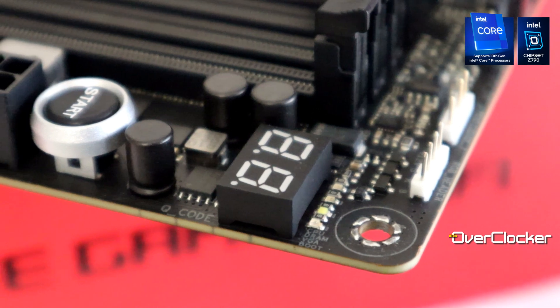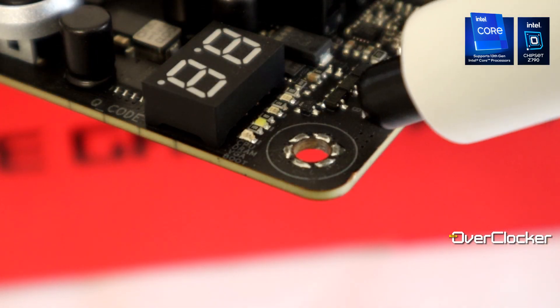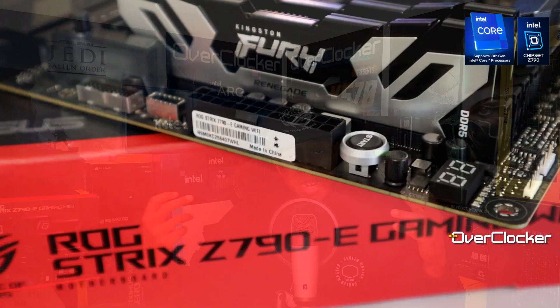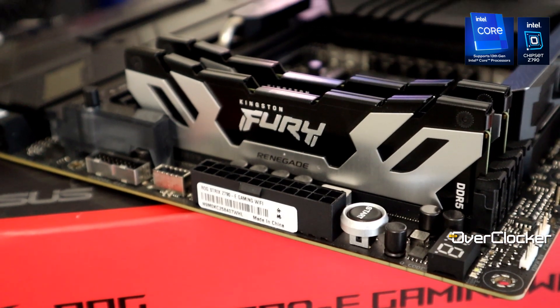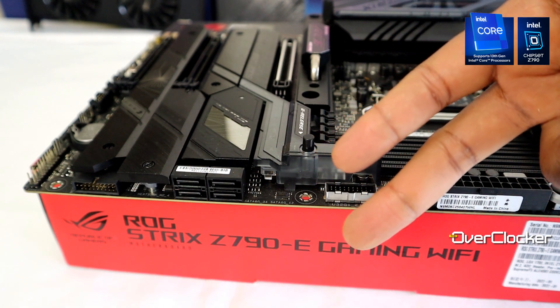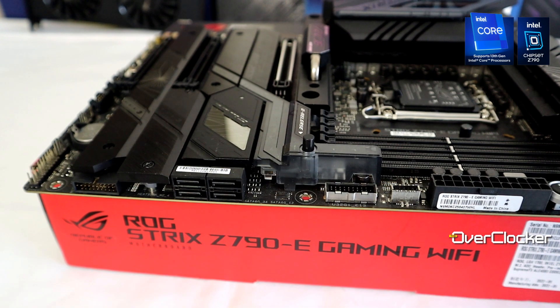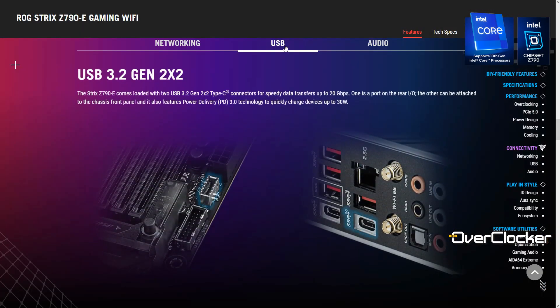You're going to get the Q Code, which is a postcode LED, along with a power button and postcode lights — a simple way to monitor the boot process. I didn't find myself needing to use the postcode LED much, but on a $500 motherboard it's appreciated that it's here. On the board itself, you get two USB 3.0 headers — 5Gbps ports — so you can have four outputs on your front IO. In addition to that, there's a Type-C header that is PD 3.0 compatible, meaning you can quick-charge your tablet, phone, or anything that supports that power spec, delivering up to 30 watts.